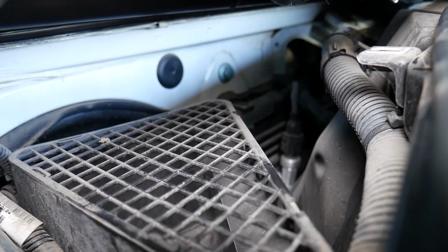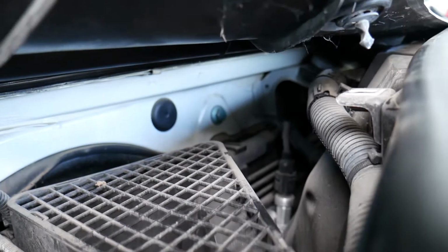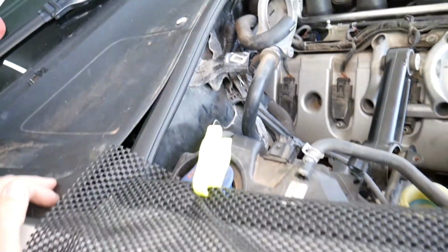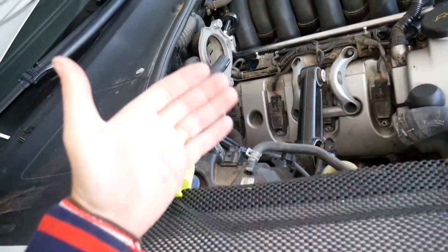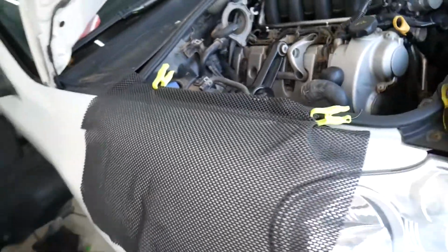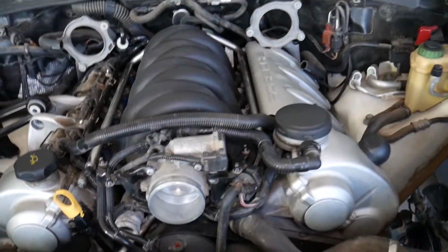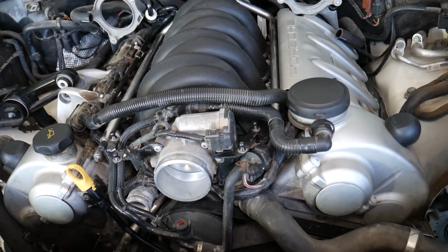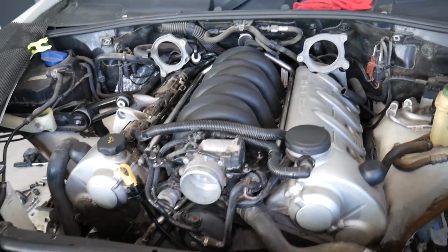Now, how do you remove those? We have a video that explains that. With some switches you have to drain the system completely, depending on which design you have, because otherwise if you remove that switch, all the freon will come out. First, it's illegal, second, it can severely hurt you. So I recommend having the AC system vacuumed down so they remove all the freon. Any shop can do that for a minimum fee, and replace that switch and just recharge your system after that. Start fresh, that way you have fresh freon as well.